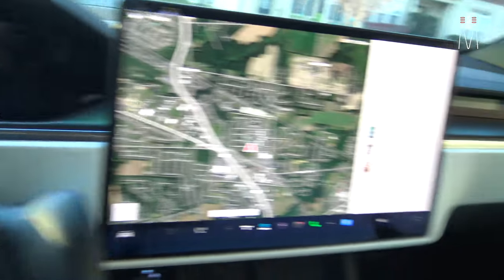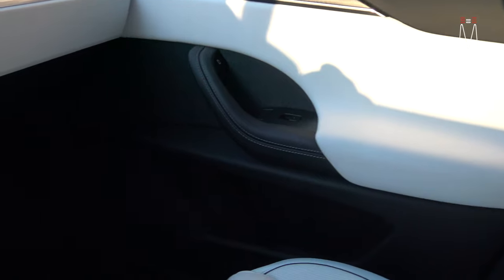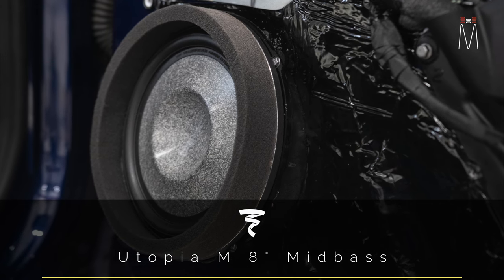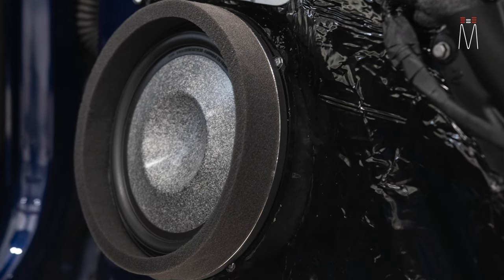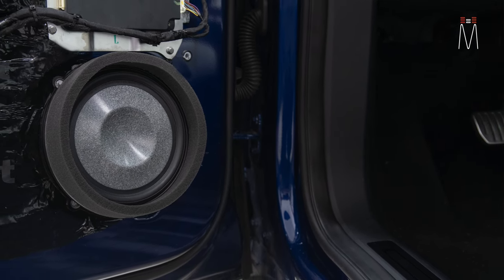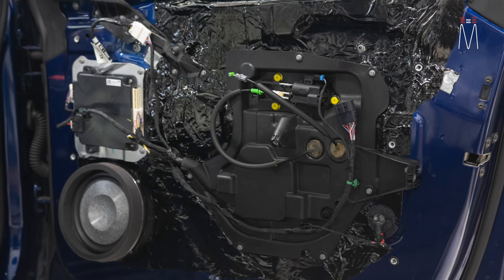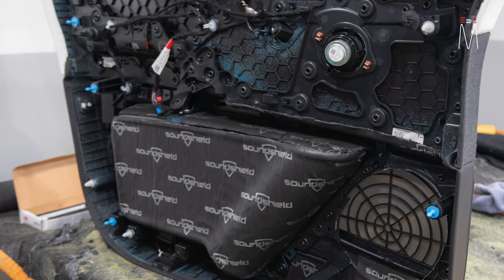To run you through the audio system of this interior — very straightforward and easy to integrate. Behind this door we have an eight-inch Utopia M mid-bass. This integrates into the factory speaker mount — we create an acrylic speaker adapter that mounts to the factory location of the door so nothing has to be cut, nothing has to be modified, and the Utopia woofer goes right in. When we sound-treat these doors, we fully remove the glass and get the inner and outer door skin fully covered with acoustic foam behind the entire door panel to ensure no rattles or resonance.